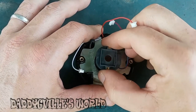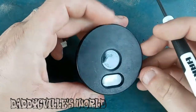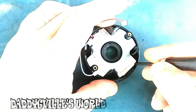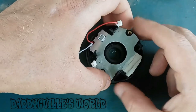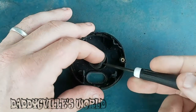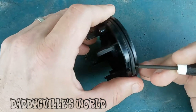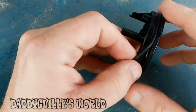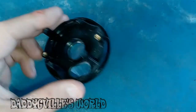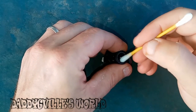Now gently pull up on the camera lens and remove it from its seat. You can see the light and the night vision lens is still in, held in by two small clips. Gently push one back and lift up the edge. Now pop out the foam ring that holds the camera lens, then remove the outer rubber seal without damaging it. That's just a piece of plastic. I took mine in and washed it under some hot water with some Dawn dishwashing liquid, then used a q-tip with some lens cleaner to help get the inside and outside crystal clear. Then I cleaned the front and back of the lens with a q-tip and some lens cleaner until it was crystal clear.